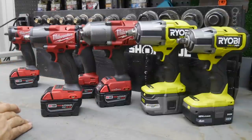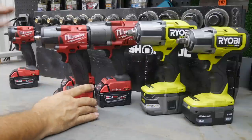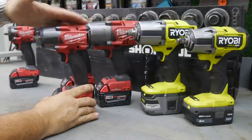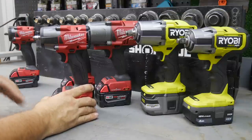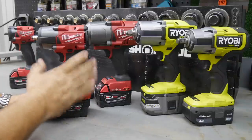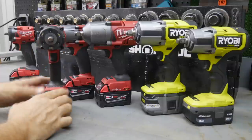A couple of years ago we saw the release of the mid-torque impact wrench. After that, Milwaukee came out and said they were revamping it, making a new mid-torque model. So we went from the old 2860 to the 2960, an update in the mid-torque design bumping the poundage up a bit - now at around 650 foot-pounds for both fastening and loosening. In the mechanics world we're mostly worried about loosening, and we're hitting those numbers very easily with the mid-torque.